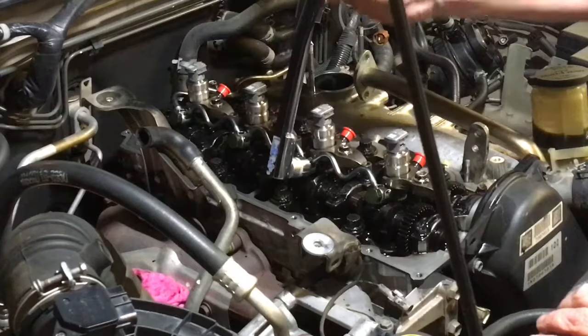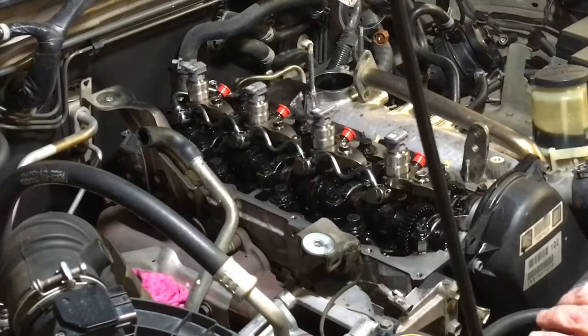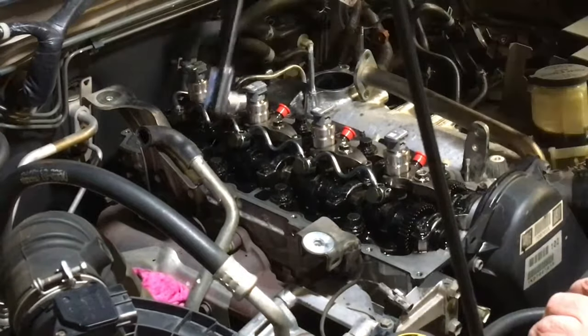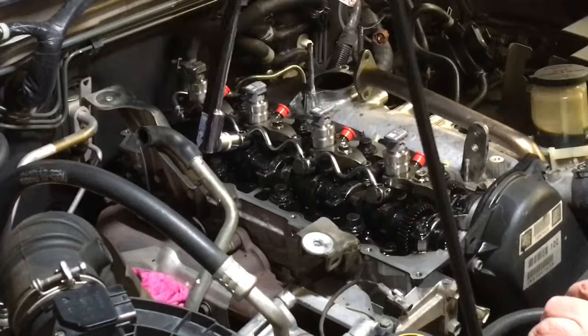So it's funny how it clicks, and then usually when you stop and get going again, you've got a, if you know what I mean. So if you're tightening up a bolt and you're on the move, that'll give you an accurate setting. But if you stop and start again, there's going to be more tension there and sometimes it's going to click prematurely, if you know what I mean. So funny, these are clicking on the move and then you go to double check it and they move a little bit. That's what they do though, right? But if you think it through, it's a bit unusual.